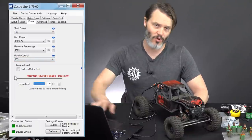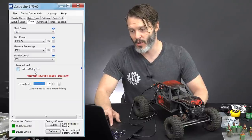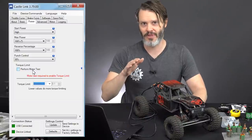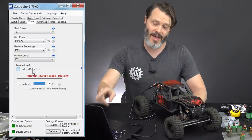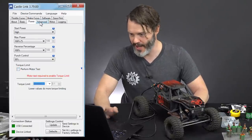If you do all this programming and still need a little more low speed control, the torque limit with a motor test can give you better startup, but mostly in sensorless cases. You'd use this if your motor is starting and stopping repeatedly. I really never have problems with it, especially since I run a sensored motor on this rig, so we are going to forego that.